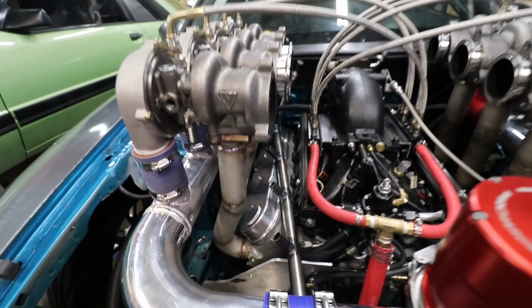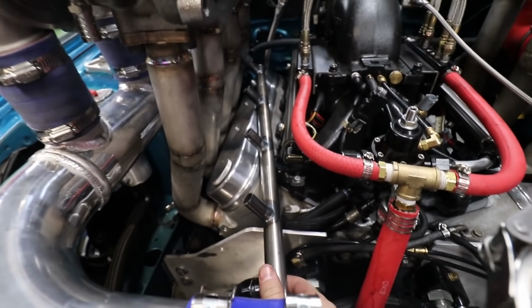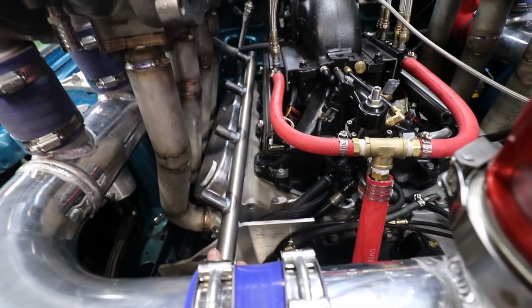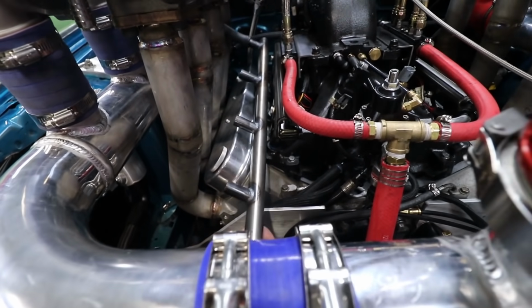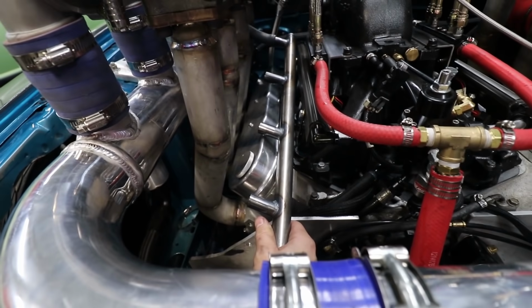Okay, I think I have a solution to our problem here. You can see that our rail, we built it with a 13 degree angle, and that was when we had it at a 13 degree angle directly underneath. But if we put it here, we no longer want our 13 degree angle, we just want to go in straight. So now our 13 degree angle is throwing us off.